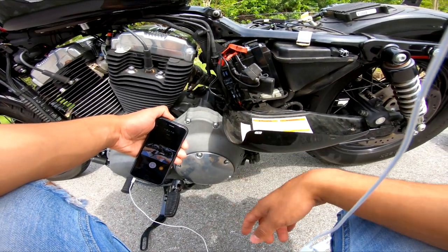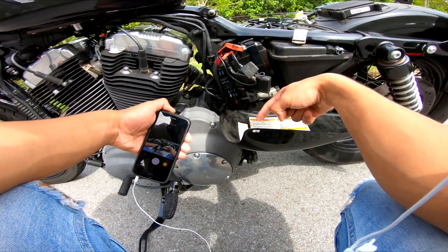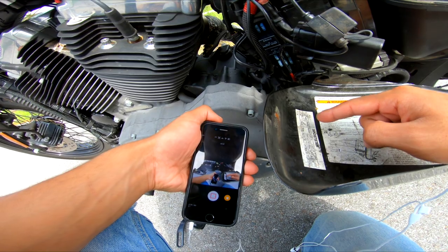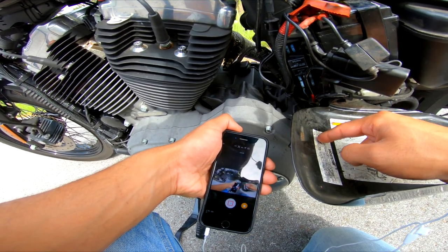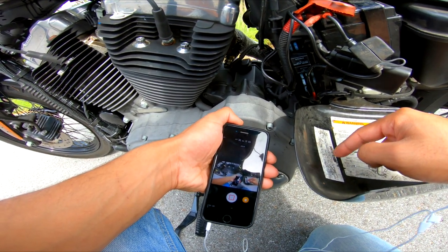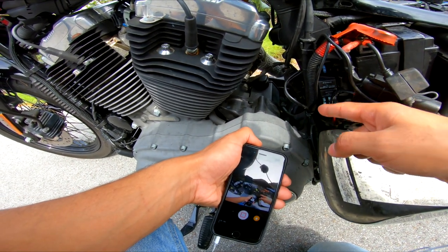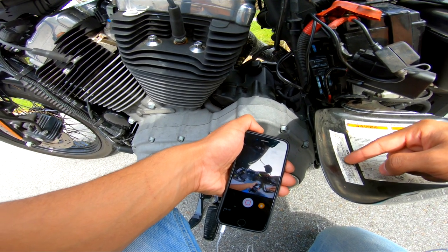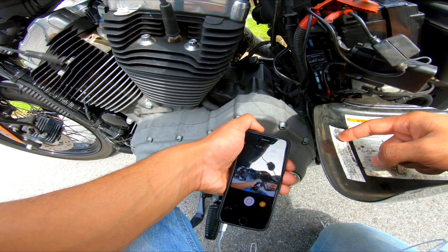For those of you who don't know, your fuse diagram is right here. When you put it down it's actually facing you. The top three are the top three on the fuse box, then you've got your starter relay, then your system relay, and then some of those are spare 15-amp fuses. If it's not one of these, definitely check all your other 15-amp fuses — you have one for your ignition, one for your ECM, and one for your fuel pump, so that could be it as well.